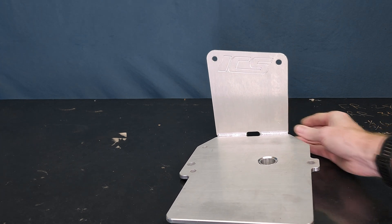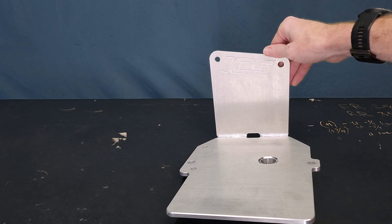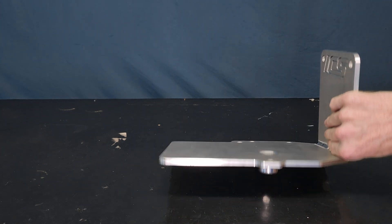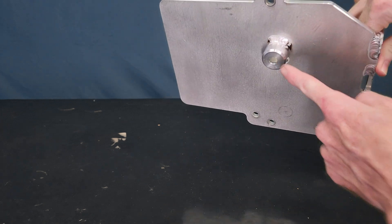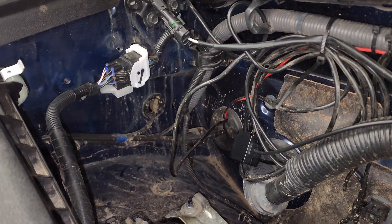This is the pride and joy — this is the ICS battery tray itself. The way it works is it sits behind the airbox on the passenger side. This part bolts up to the fender; there are already threaded holes from Toyota. There's also a nut on top of the wheel well that holds it down. I'll show you how the rods and everything work. This is a heavy duty tray and it looks super simple to install. It's set up for a Group 34 battery, so that's what I purchased. Once it's installed we'll hook up the RedArc charger and run accessories.